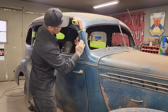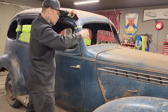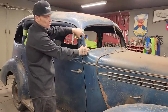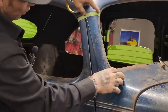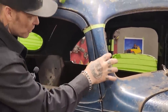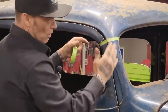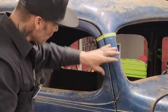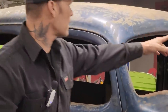I'll set it back down, cut this pillar, relieve this pillar, and make them come straight. I'm gonna have to pull this out and take some meat out of the center, because you can obviously see it's a better distance in the center — that's quite a width up here compared to here. So I'm gonna pull this post out. I want this width here, take it at the center, weld it back together so it's nice and straight, and then when I put the post back in it'll lean straight. I'm not sure yet what I'm gonna do with this other post.